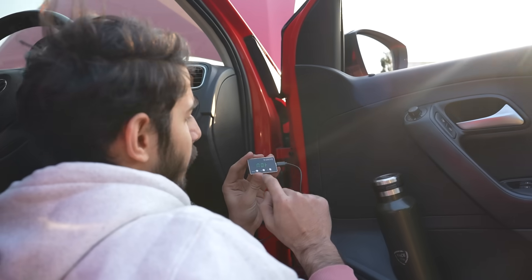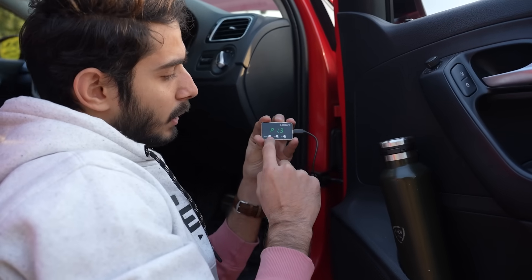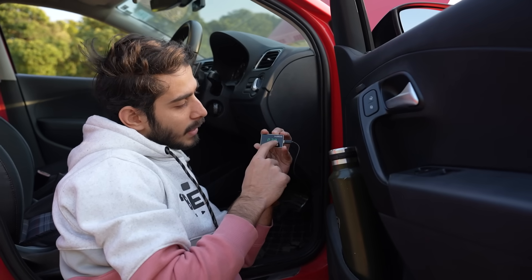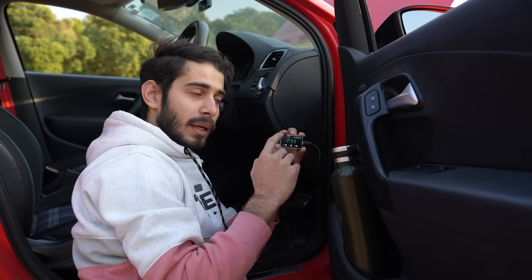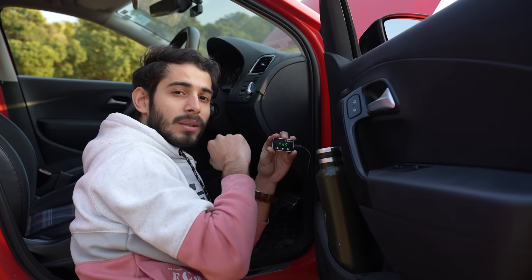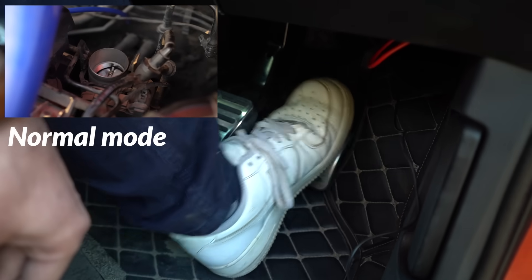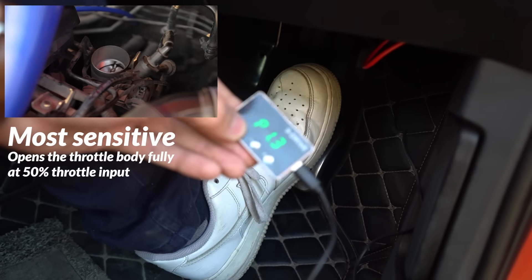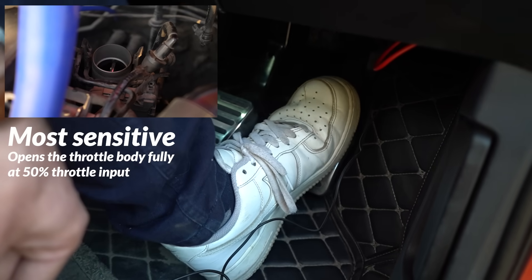Let's install it. As you can see, it has been powered. This is normal mode. If I click the mode button it goes into P1, which is power 1. Then it says 0.3, which is the sensitivity setting of that particular mode. If I go to P3 and sensitivity 9, this is the most reactive that it gets. Anytime I press the throttle pedal, there is going to be zero delay and it's going to open the throttle body right away. Not only that, but if I press 50% of it, it is going to open up a little bit more at the throttle body's end. In normal mode this is full throttle, this is zero throttle, and this is about 50%. And now in the highest sensitivity mode — this is full throttle, this is zero throttle, and this is about 50% throttle.